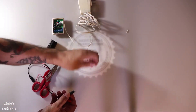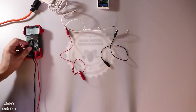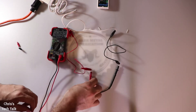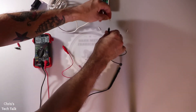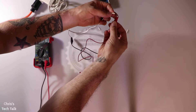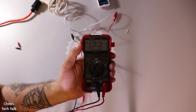To test them just for safety I'm going to use alligator clips. I'm going to clip a black alligator clip to the white and black wire and a red one to the solid white wire. Next I'm going to set my multimeter for DC voltage and clip in my positive and negative leads. Here you can see I was getting negative 12.3 volts, so I'm going to switch the alligator clips because now I know the polarity. The white wire with the black line in it is going to be my positive wire, and now you can see I'm getting 12.3 volts.